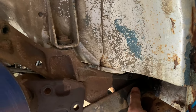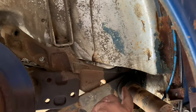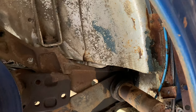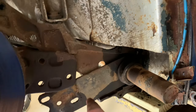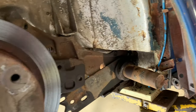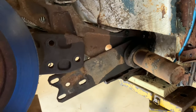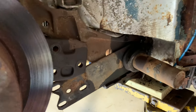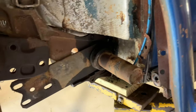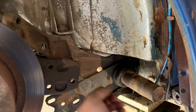This is just a rubber bushing, and there's another one on the other side. Your torsion bar spline runs through here. Now we've got to knock this out. When this thing comes off the stop, it's going to come down with extreme force. If your hand is there, your arm is there, or your head is there, it can hurt you very bad or kill you. So this can be dangerous. You want to make sure you're not under it at all. You're going to hit it from the backside to knock it off the splines.